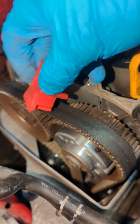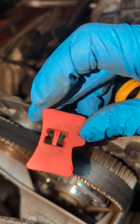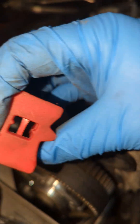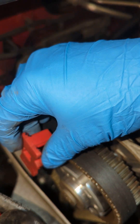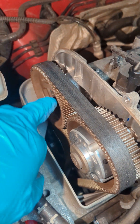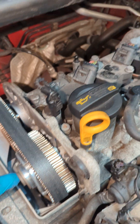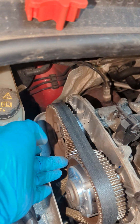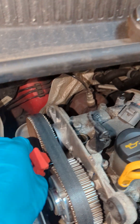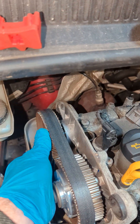You get this tool as well - this cheap plastic one. You can see it's a bit worn there; it does take quite a bit of force to push in. These teeth or arrows line up with the marks on the pulley, and they only go in one way because those pulleys are egg shaped. It took quite a bit of force to actually push that end in - the plastic moulding is just a bit crap. In the end I never undid these bolts; there was literally no point whatsoever, because they've got to go back exactly where they are. When you start and when you finish this has got to fit in, so if you freewheel these it doesn't achieve anything.